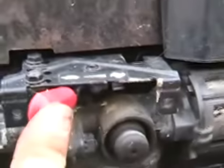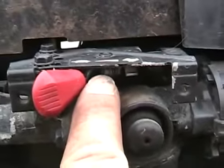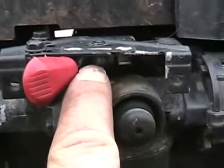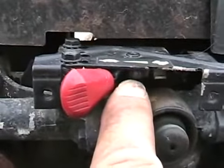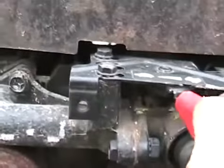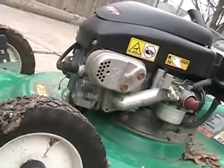Now we get down to the nitty-gritty. You have one of those high-tech flat screws — the top flat screw, not the one that's farther back, is the one you adjust. You screw it inwards to make it go faster when you move the throttle to fast. So it's your governor override and adjustment. But of course, behind the air cleaner, just like the other model, it has that lever you can adjust too.